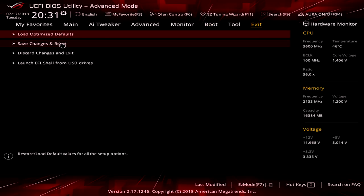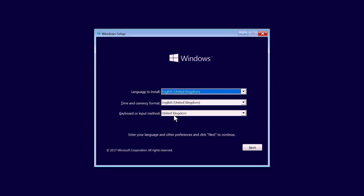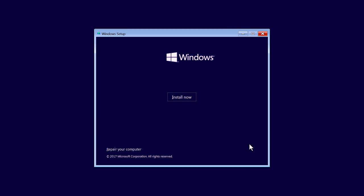I love the ASUS BIOS — it's very easy to use and very graphical. In here you can do all sorts of things like overclock your CPU or your RAM. We're not going to touch that quite yet, because what we want to do is select the USB we inserted as a bootable device. Go to the boot menu at the top — here we see our JetFlash Transcend. That's our USB, set it as boot option one. Save changes and reset. Now we find out whether this actually worked — and here we go, we're into the Windows installation menu.